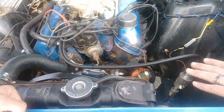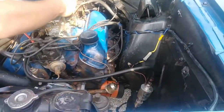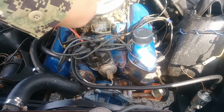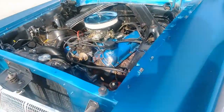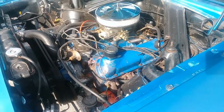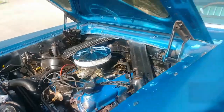It's not leaking, but it could be a problem if I want to change the water pump and that bolt breaks - it's part of the block. If it were part of the head you could just change the head, but it's part of the damn block. You could weld it - that'd be the only thing you could do. Or just drive it around a little. This thing is rad, damn - it's sweet.